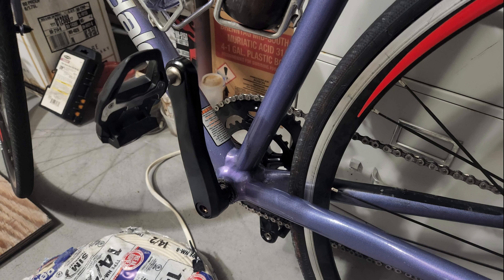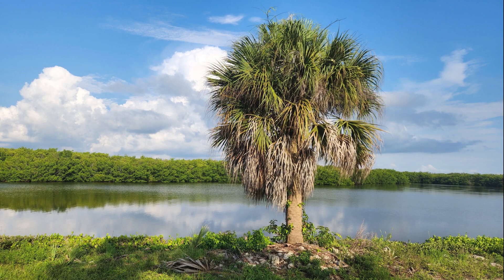Overall, how long did it take? Quite a while because I'd known it was broken and just kept riding it all week, then last night I thought okay, now it's time. I took off the pedals and got to work. The actual Dremel grinding was probably the hardest work. Make sure your tools are good — I used a new Dremel metal cutting disc and got everything tight. If you're not careful, it will bind and the grinding disc can fly out or break the retaining screw. It gets hot too.